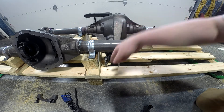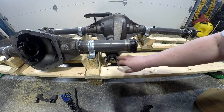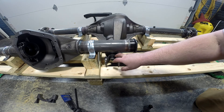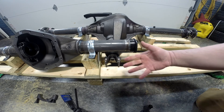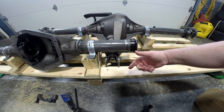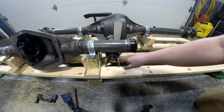The pinion length is different anyway — the distance from the axle centerline to where the center of your u-joint is going to be is different from a Dana 60 to anything else, so you're going to have to rework your driveshaft. They do offer a conversion u-joint to go from 1350 specs to whatever may be on your driveshaft. As an option you could have your driveshaft shortened, or just go ahead and have them put a new yoke on the end for the 1350 joint.